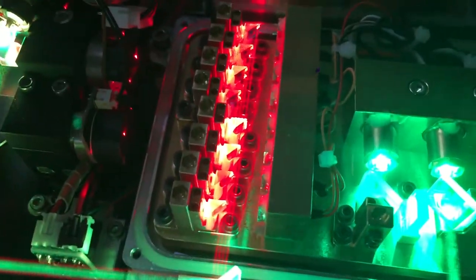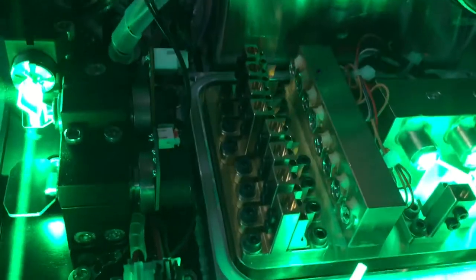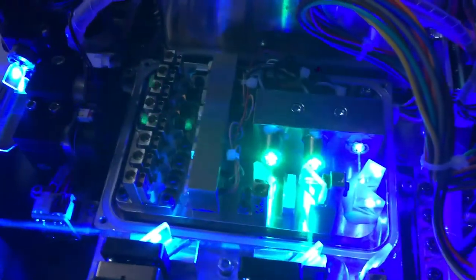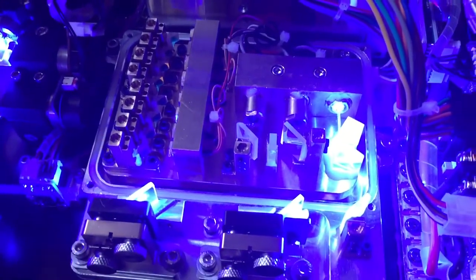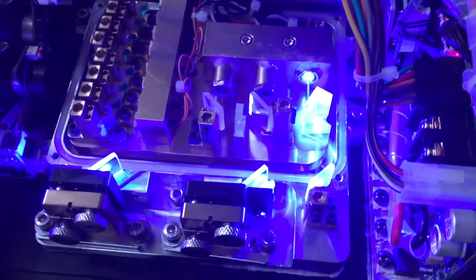For the red channel, you have this setup where you have lots of individual tiny lasers combined. You can see each one of those laser diodes in there. The reason this is done - since this is actually a rather nice projector - is that it improves the quality of the beam. But it is a little bit of a nightmare if any one of those tiny little mirrors in there gets out of whack. Luckily, that hasn't happened to me yet, and I've only had to adjust a couple of things in here like I was doing today.